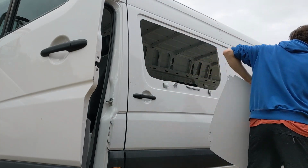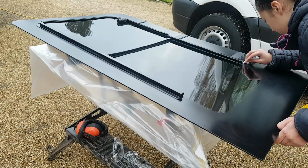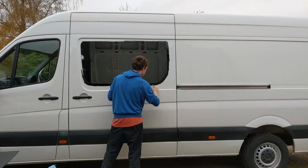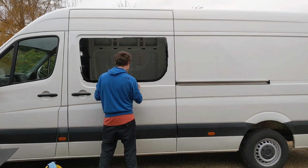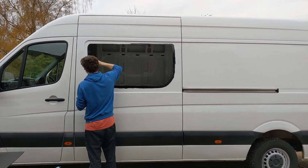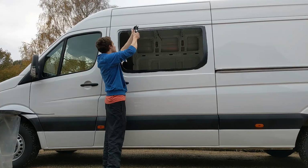After you're done cutting, you should file and paint the raw metal to prevent rust. Alex is painting on our primer. So the kit that we bought for the window came with basically a paint primer.